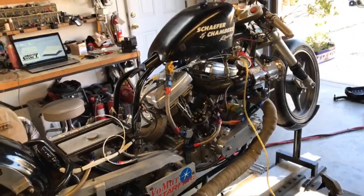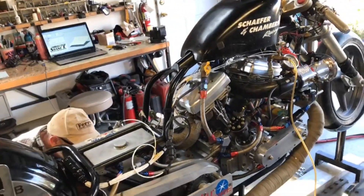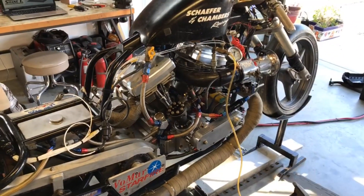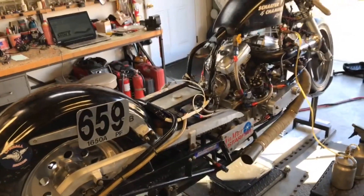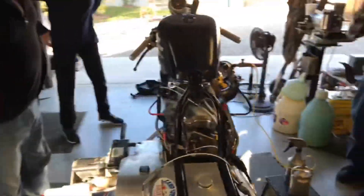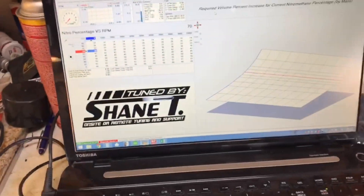If it works there, the next move is to go to Bonneville. We've already had the thing running on alcohol. The procedure is to start on gas with this mechanical setup into the intake manifold, then switch the fuel system to nitromethane and let it run on nitro. We're relying on the mathematics and the measured nitro percentage to see if this thing is going to run correctly. Let's find out — we're all going to learn something.